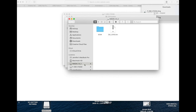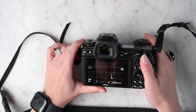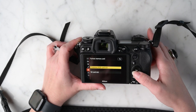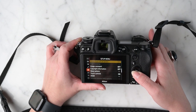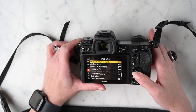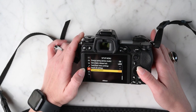You don't want to go into anything in the folder — just eject the card. Put the card into your camera, hit the menu again, and scroll all the way down to firmware version, which is under the wrench.